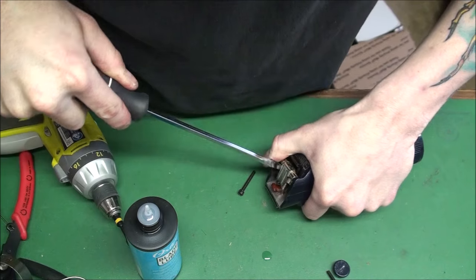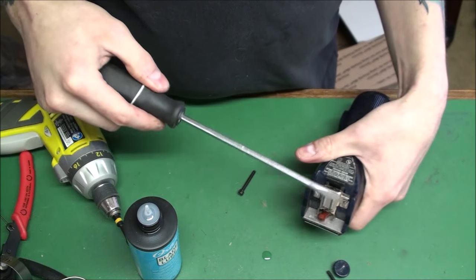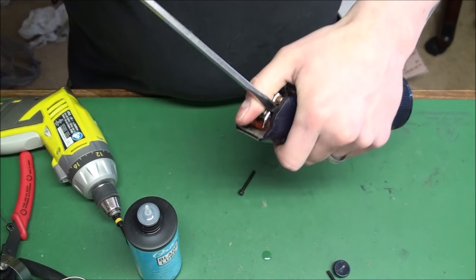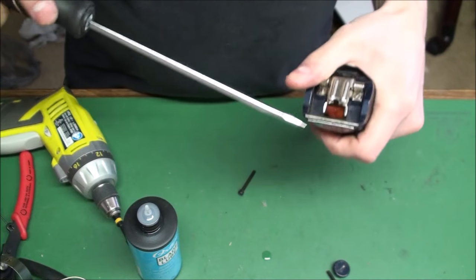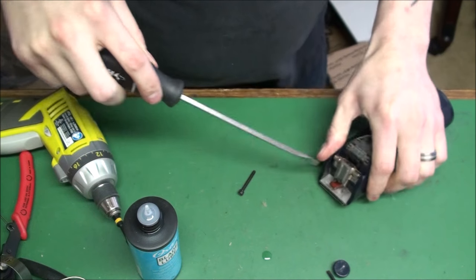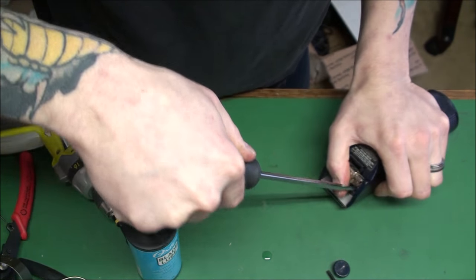You want to get these serviced because if it runs hot for a long time, you'll warp the armature — and what that means is it'll wobble. When it's going fast you can feel it bog down. So if your clipper does that, you probably need to clean the hair out or you're going to need to buy a new armature.